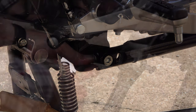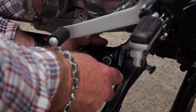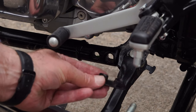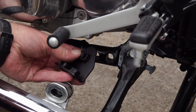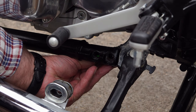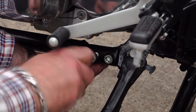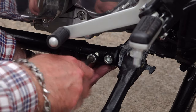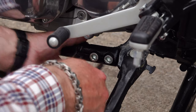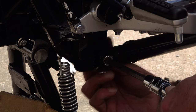Going back to the left-hand side: remove those two fasteners and at the back there's a flat connecting plate with two captive nuts. This will be replaced with one of the brackets from the kit, so store the original plate somewhere safe in case you want to return the bike to normal later. Place the new bracket on the back, reinsert your bolts and snug them up — but don't fasten too tight, as you still need to be able to adjust the angle.